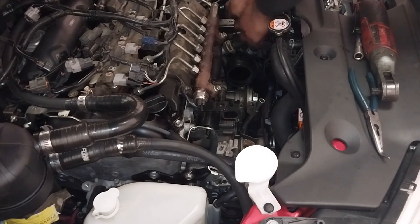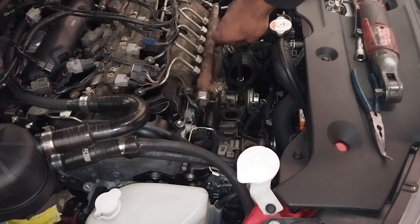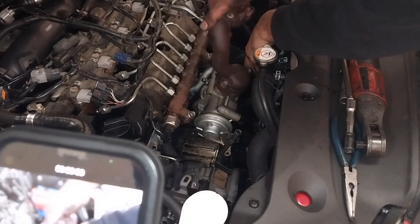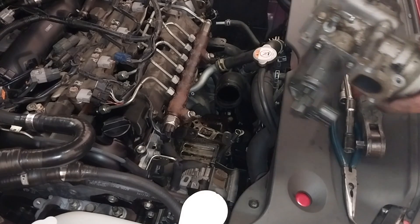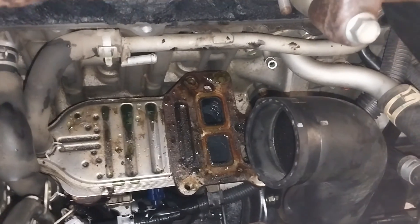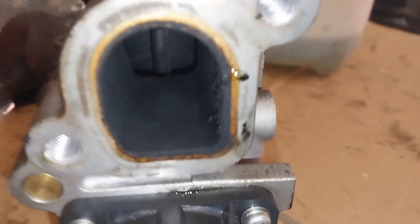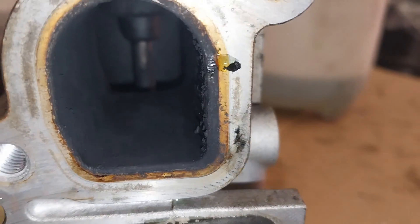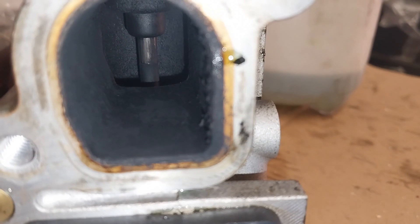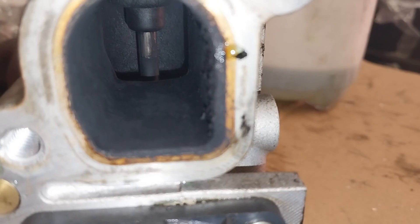Now I'm going to remove the EGR valve, just making sure there's no carbon. I'm going to do a bench test on the EGR valve vacuum — the cooler bypass valve — because that's one of the common issues on the Mitsubishi EGR valve. You can see the actual shaft has polishing and scoring marks — hopefully the valve is still working.